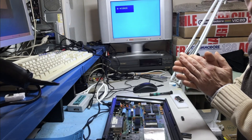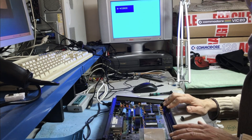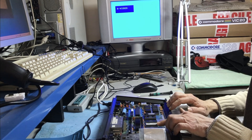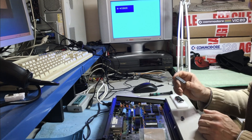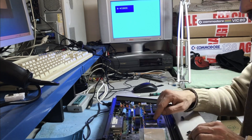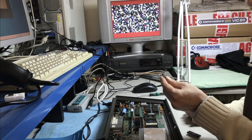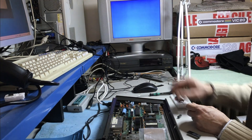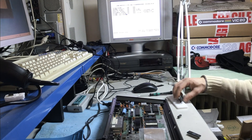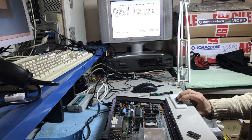A little jump into the future: while I was playing with the Plus 4, I got a problem — the screen went blank again. I checked all the connections and everything seemed okay. Then I programmed the Diag 264, removed the kernel ROM and put it inside, because it's possible to use the Diag 264 that way. It helped me find the problem — it was actually a RAM chip I had already replaced. Now it works well. I also tested it with the FrankenCPU — it works, which is useful to know for any future testing on this kind of machine.